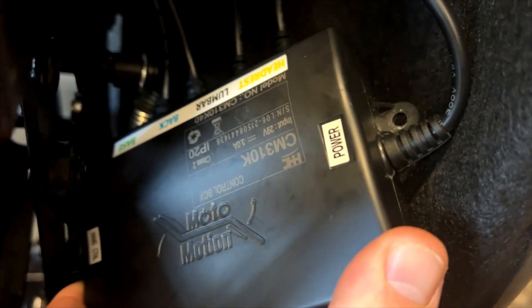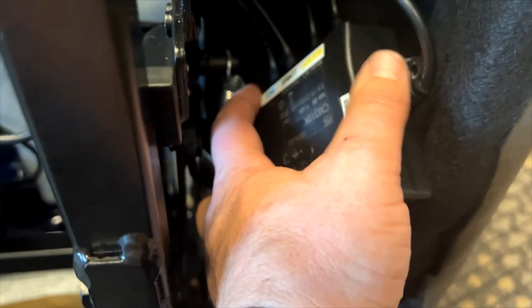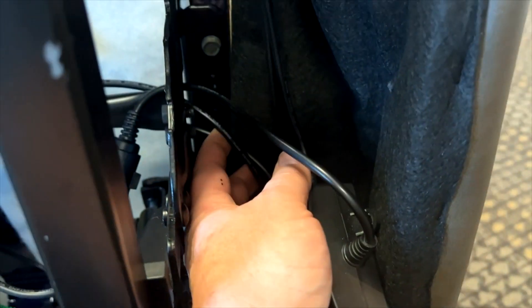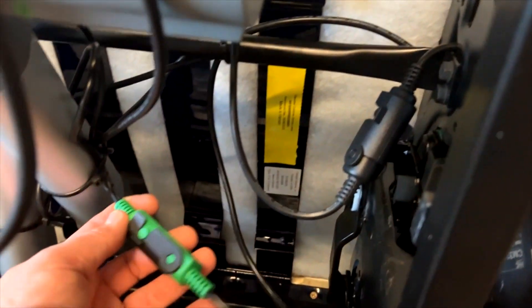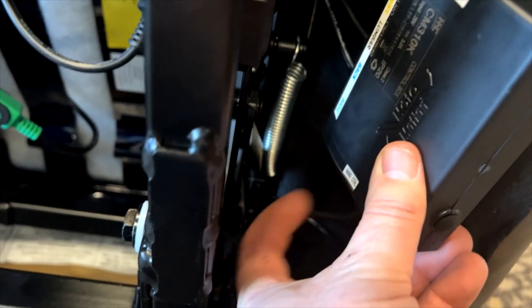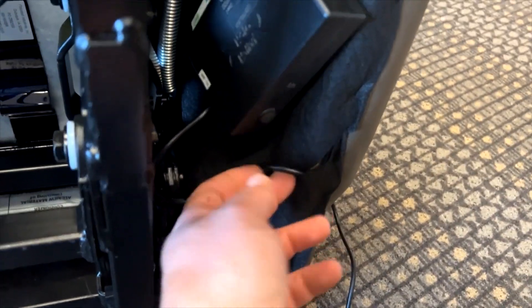Next is the base motor — that wire comes out and I'm checking to see if there's anything wrong with the insulation. It comes over to this connector and everything is connected properly. Then the final wire here is for the hand control, which simply routes right here, goes through the upholstery into the pouch, and there's the connection in there with the hand wand.